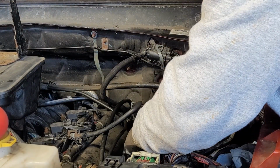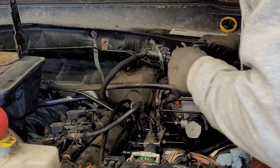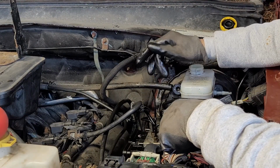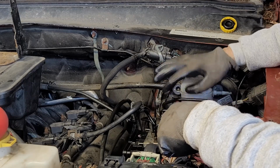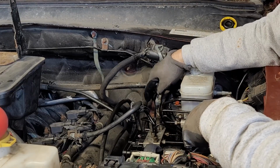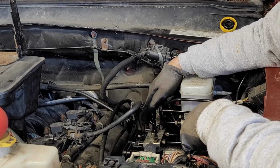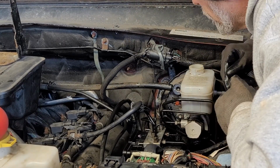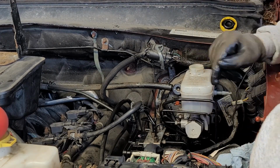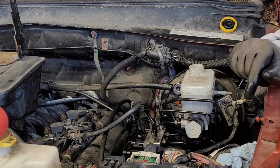Alright, there we go. Now again, I got the 2 lines coming from the master cylinder into it loose, because we'll get as much air out of your lines coming from your master cylinder. Thing is, you're going to have air in your main lines, unfortunately. So that will take some bleeding to get that squared away. All right, look at me here.